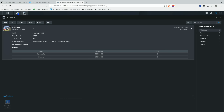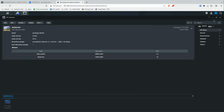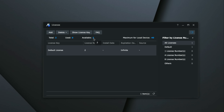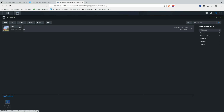One advantage of using the Synology camera with Surveillance Station is that Surveillance Station can manage the firmware — it will download and install the latest firmware automatically if you want, so you don't have to manage that on your own. Also, if I look at the licensing screen, although I have a camera installed I still have my free two licenses available, because the camera comes with its own license and doesn't eat up any license slots.